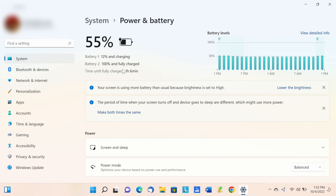So we just had to reinitialize the battery and now it's all working. This T480 has two batteries and you can try this method first. Removing the external battery, booting up, confirming the internal charges, shutting down fully, then reinserting the external battery — this might actually be faster than the driver method. If you had just bought a new battery, you would have accidentally reinitialized it anyway just by swapping it.